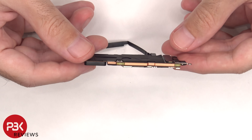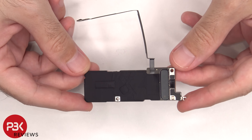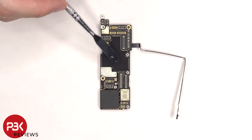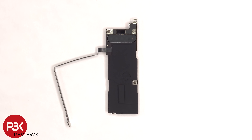Here's a better look at the dual layer motherboard. On this side of the motherboard there's some graphite film over the shields to help transfer heat. Here's a better look with the graphite film peeled off. On the back there's another 5G millimeter wave antenna and some more thick graphite padding to help transfer heat.